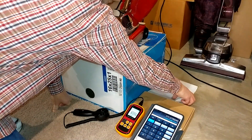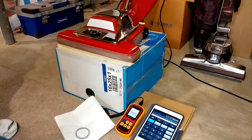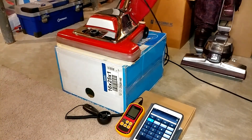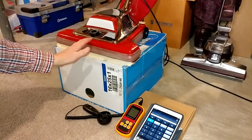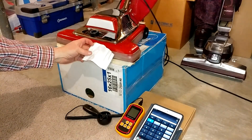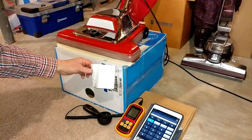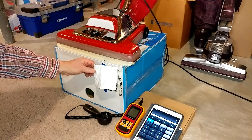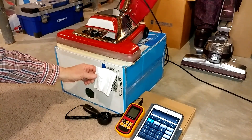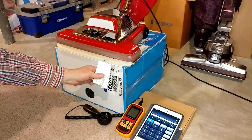Let's go ahead and do the incredibly difficult and complicated procedure of putting an F and G bag in there, and go ahead and re-measure. After taking a considerable amount of time installing the inner F and G bag in this SC-899, let's see if this small modification that I made makes any difference. I trimmed a few inches off of the fill tube to make the inner F and G bag sit down further — or maybe just, you could say, it's easier to install so the bag sits down further. I wonder if this will allow more airflow through the top of the F and G bag, which is critical, where it doesn't get all pinched because the fill tube is too long. Let's see what happens.